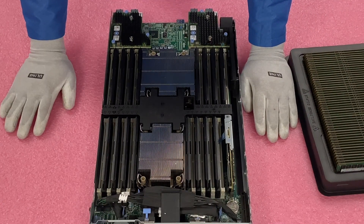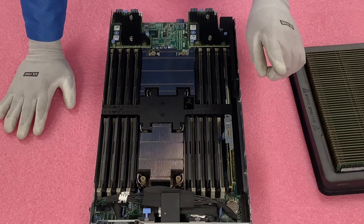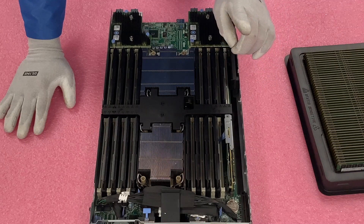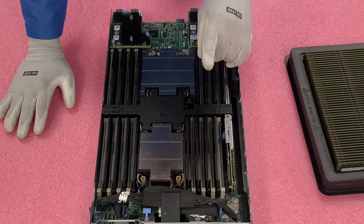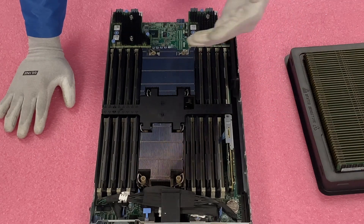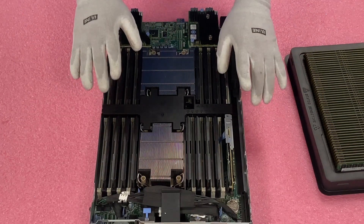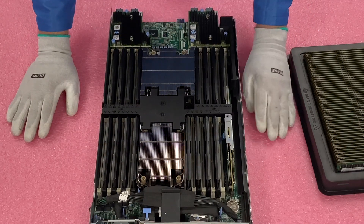The channels are important. If you're only putting in eight or 16 DIMMs, you want to make sure that you're installing them in the correct slots, which will be all the white slots. You will not actually start using the black slots until you get past 16 DIMMs. The reason being is you want max performance — you want your DIMMs evenly spread out across all the channels so all the channels are performing equally and you don't overload a few channels.